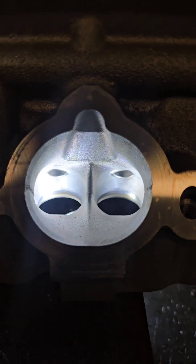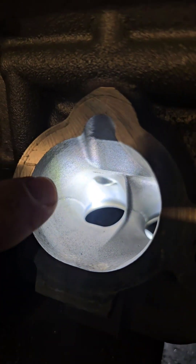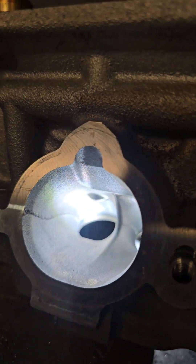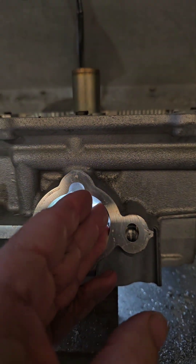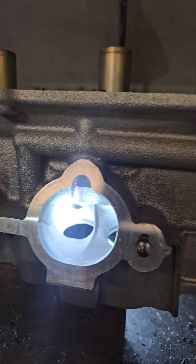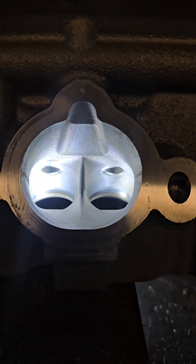Quick glance — as you can see we've got a little pinch just inside the window. Like most casted heads you can see they do this little four or five mil ramp in. This just helps with port alignment, so when OEM don't quite get the casting right we don't have a hard edge that the air is hitting. If the port's off slightly it'll hit that little ramp — it's not optimal but it gets them out of trouble for an OEM head.